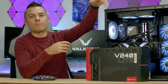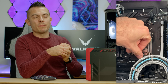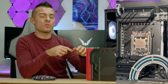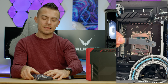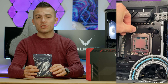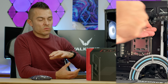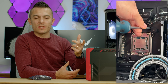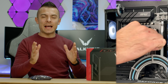Assembly is easy. Eight screws on top secure the radiator, since the fans come pre-installed. For the pump block mounting on AMD, you remove the original retention brackets and use the provided screws. Additional AMD screws for the retention brackets are included in the accessory box. Thermal paste is included in a tube, though it also comes pre-applied on the block. You place the new retention brackets — which look similar to those on the Lian Li — then add side retention brackets, tighten the locking nuts, and place the AIO.